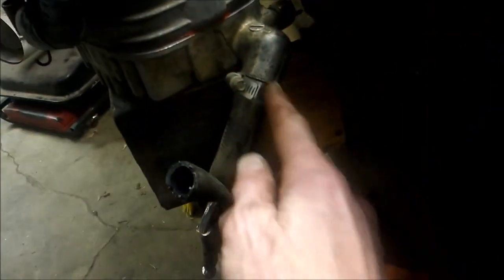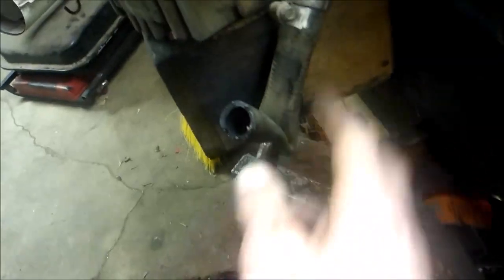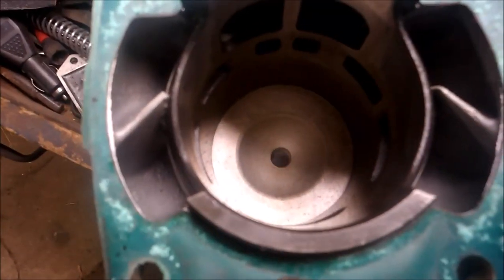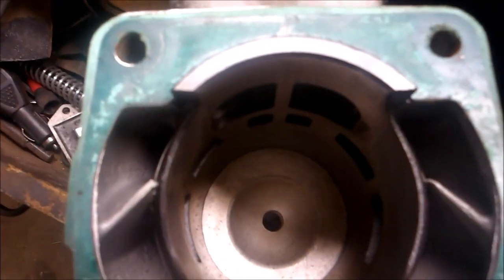All right, so I'm going to show you one little test. I put a hose clamp on, cut this off, put a hose on it and just clamped the holes. Something drains out - I grabbed my bucket down here with coolant in it and put it into this spout right here. The head is upside down and I have coolant flowing through the jug right now. If you look at the base, there is not one single drop of coolant, so that tells me that wasn't the issue - it's not leaking.